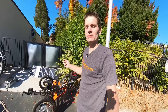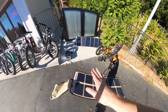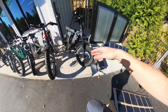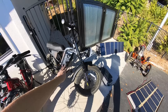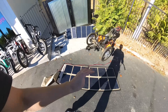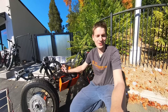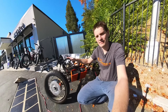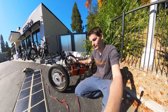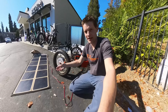These things are super efficient — we're talking like 96% efficient, sometimes more. To put that into perspective, let's say both panels were equivalent — we're getting 100 watts out of each. If the battery bank setup is only 50% efficient, I'm only actually getting 50 watts to the battery. With this direct DC setup, I'd be getting closer to 96 watts — almost double. So you can see why I prefer this setup in certain scenarios. It's so much more efficient. The reason I have this trike set up this way is because I intend on having a body covered in solar panels when this is complete, so it can charge from the sun even while I'm riding. I don't have to stop and fold out a solar panel, so for that reason this setup makes way more sense.